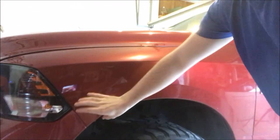It was just a little loose, and that's the cause of it. I know that if you have mud flaps on, like these ones that come up along the body, there's a potential of rust rotting out because it traps in moisture, just like how fender flares do it. If I were to have a fender flare, it'd come on over here and go all the way down. What people normally do is get them to hide rot that's already there, but sometimes they put them on because it looks cool, and I grant, it does. But it traps in moisture and starts rotting out the body of the truck, the fender. So there are pros and cons to it.